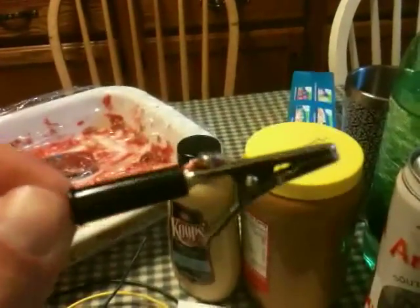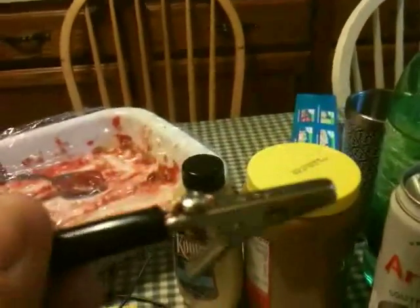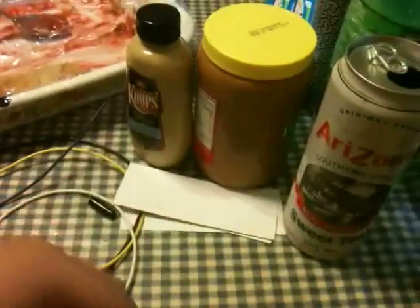You can see the finished result. I don't know whether I'm going to use some kind of heat shrink tubing or just plain old electrical tape to seal it so it doesn't run the risk of shorting against the ground or another source of power. Let's take this sleeve off and you can kind of see how I did it — I ran it up through this part, through the eyelet, and then through the opening and around that screw in the direction that the screw tightens down, so the wire would be pulled against the screw as it tightened.